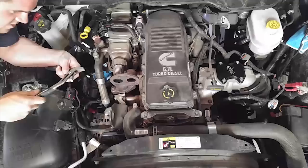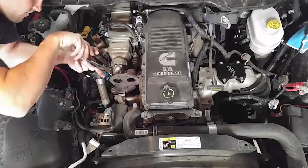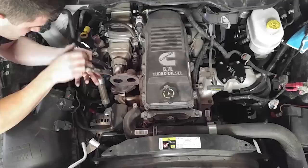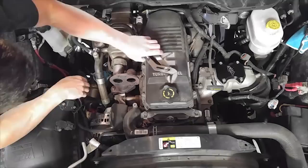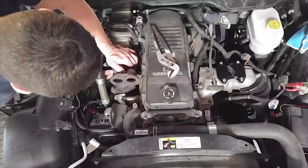After the turbo, the exhaust goes down into your DPF filters, which collect the remaining particles of soot. You also have a catalytic converter in there to keep down on other emission levels. Then you have your DEF fluid — it's basically about 67% water and the rest is urea, essentially synthetic cat urine — that gets sprayed in periodically to help clean out all that material. If you look inside a DPF filter, it is incredibly compact in there.